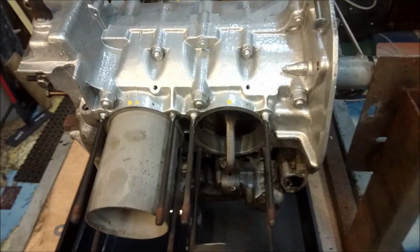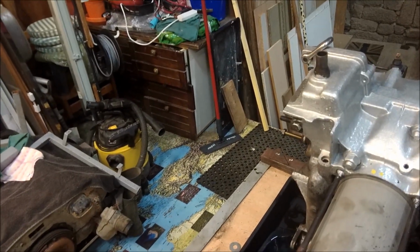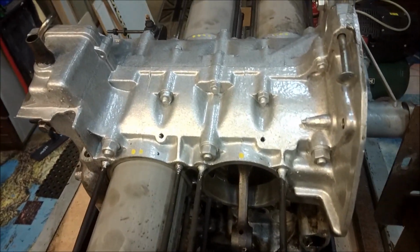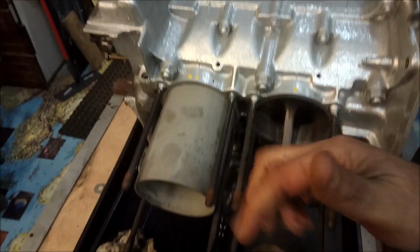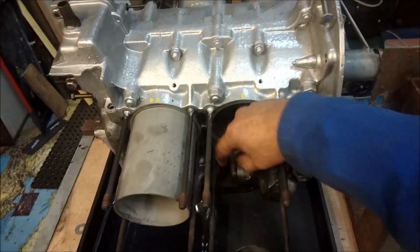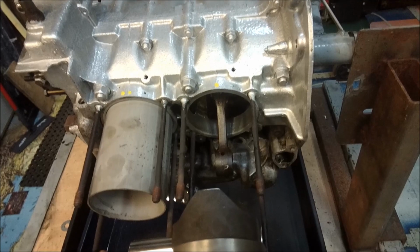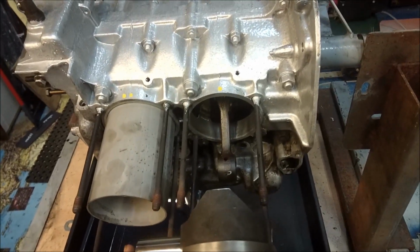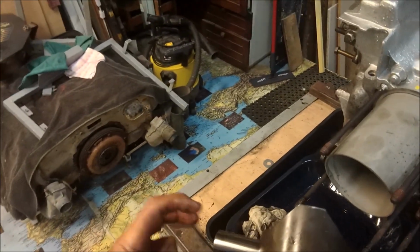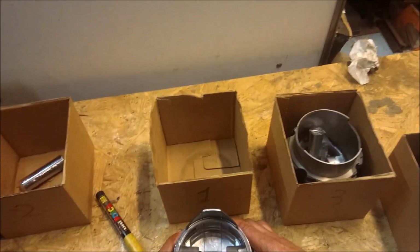We're going to want to, oh yes, and the circlip is in on this side, right, so that you can slide on. You'll be able to hook the end of the wrist pin, the gudgeon pin, just over the end of the small end bearing, and then just push him through, line it all up, and because this isn't there, you will then be able to put it in with the circlip pliers. Here we are. So each one has to be prepared in advance.